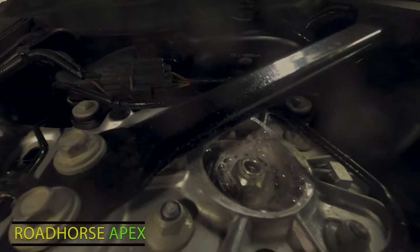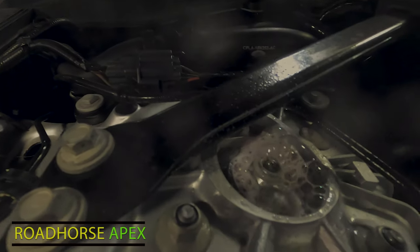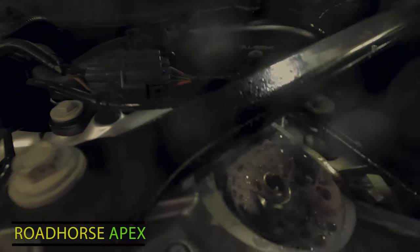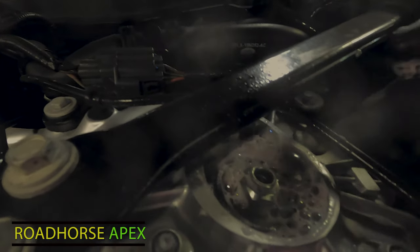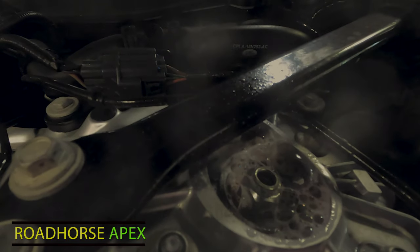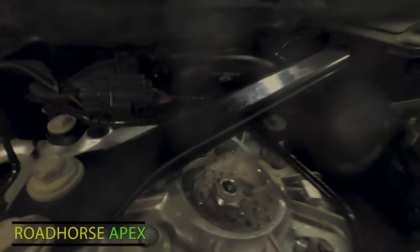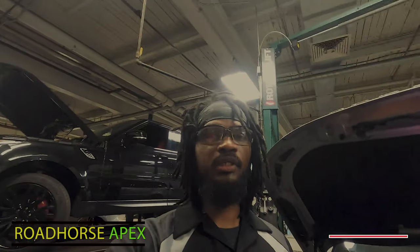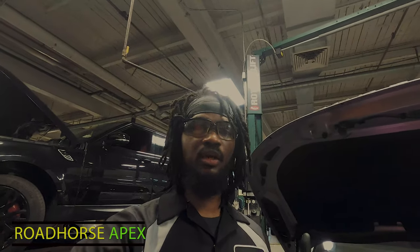Soap water, so you can see where the damage to the air spring is, and the leak is coming right out of the center where the nut sits. So that's where our leak is coming from, and that's why the suspension continually raises up and down, because it's losing air. So that's why we need to change the right front spring. That's why the vehicle continues to raise up and down, because it's losing air. So the compressor kicks in and tries to compensate for the air loss.